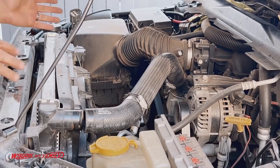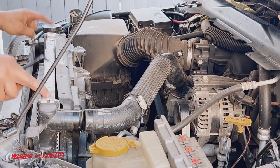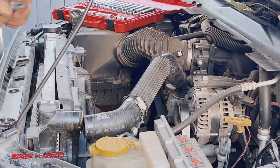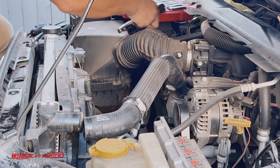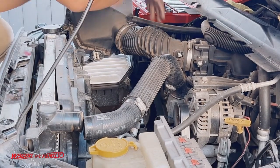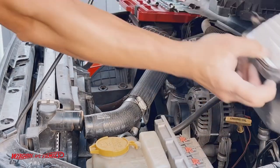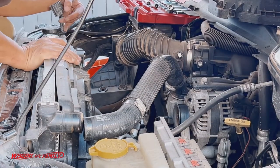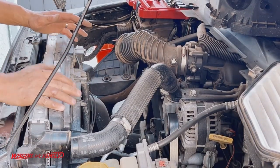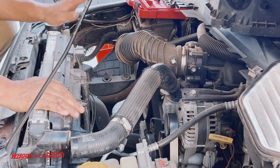Your whole radiator is now pretty much exposed. We're going to take this fan off — there's an aluminum piece right here and in front of it is your condenser, which you'll just leave as is. Looks like we'll need an 8mm and this whole box just pops right out just like that, giving you a lot more room. While I'm here I'm going to go ahead and remove the lower air hose — it's kind of tight but I'll show you guys exactly what the bolt is once I remove everything.